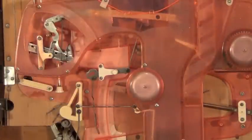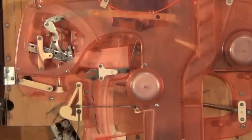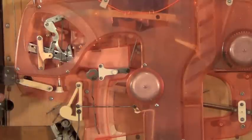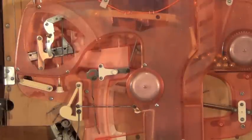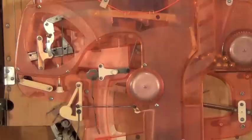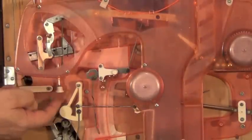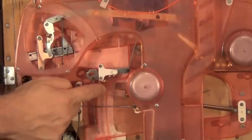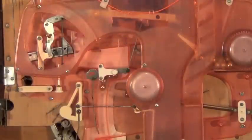Now I'm going to show you the most common problem of these machines: a ball jam. Because the one-ball seesaw is in the wrong position — it's in the down position, and that's wrong. I dropped in four balls, and the balls came over here and got stuck on this arm so they're not pivoting down. That pushes the rod all the way up to the top, so let's move up and take a look.